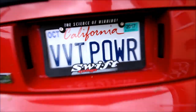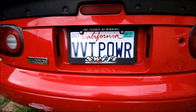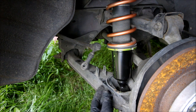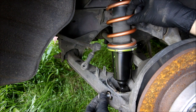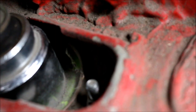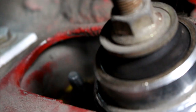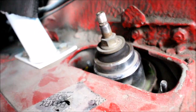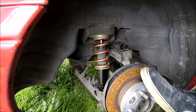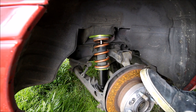Moving on to the back — we have this sick license plate that finally came in: VVT power, boys. At the back, I have the sway bar unbolted just like the front. You've got one bolt to loosen on the bottom of the suspension — pulls out. Then inside the trunk, there are two 12mm nuts, just like at the front. Using a very similar technique — stepping on the brake rotor — I'll be able to get the coilover out of the car. If you're on stock suspension, this is going to be a little more difficult because of the length, but the same technique can be used.